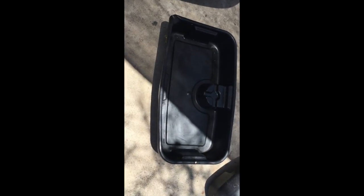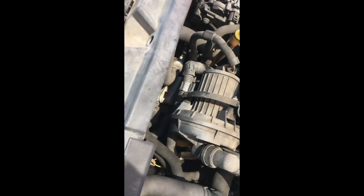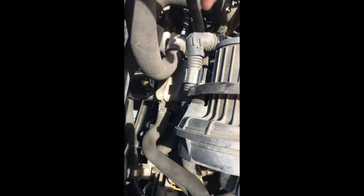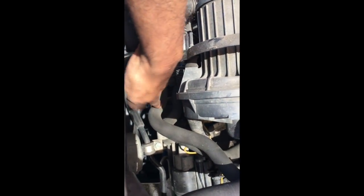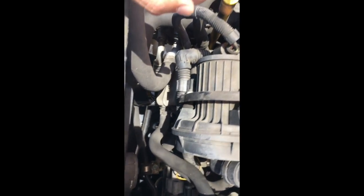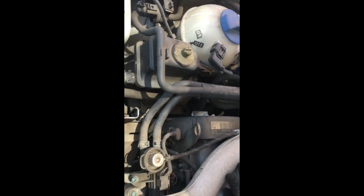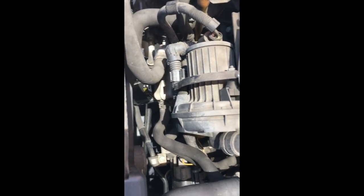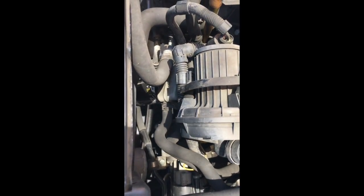I got two oil pans — one big one to catch the antifreeze and another one to pour it in when I'm done. The first step is to remove one of these hoses. There are two hoses here; apparently this is the oil cooler — there's a front one and another one in the back. I'm going to take off the back one and let the coolant leak out. I'm going to loosen it first to relieve the pressure, and then you'll see the coolant come out from the rear hose.